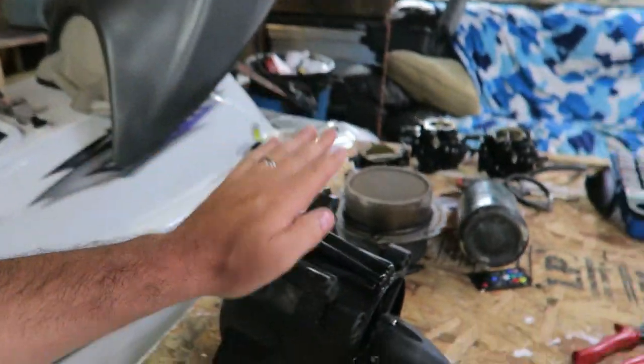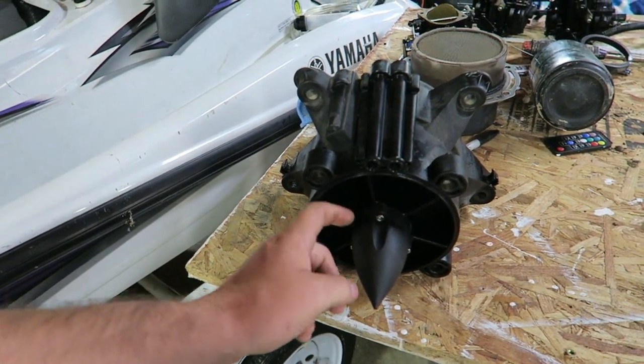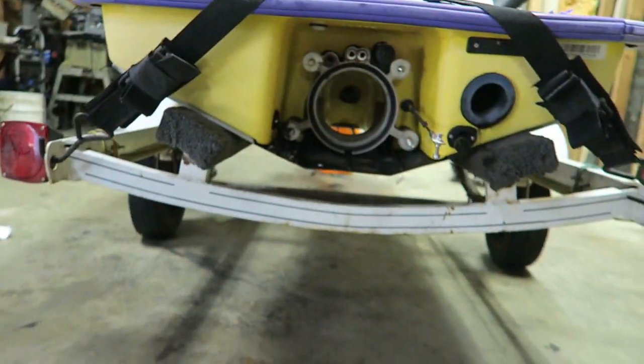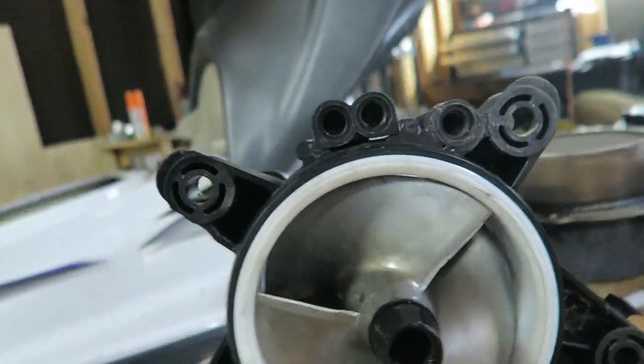Then we can put this jet pump back on and hope that it's working right, because when I got this one it was missing some parts on the inside. Still got to put some oil in there — don't forget to do that. Then we'll put it back on and take it for a rip. The first time we tried it, it almost sank and it didn't move — it was going really slow. The wear ring looks okay to me, but I'm not sure. Everything looks good inside there, maybe it's not done properly. I've got three jet pumps.